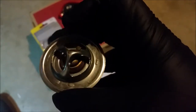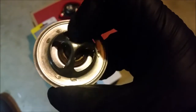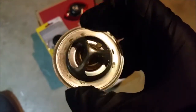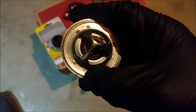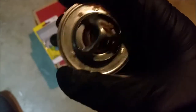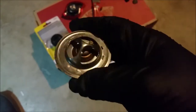You get a couple of huge advantages. Number one, the cross section where it opens is larger so you get more flow. Number two, the inside piece that opens on the Evo 8 one is actually either coated or made of silicone. The reason this matters is that the metal center section on standard thermostats will, over time and heat abuse, warp or distort, causing the thermostat not to open and close properly.